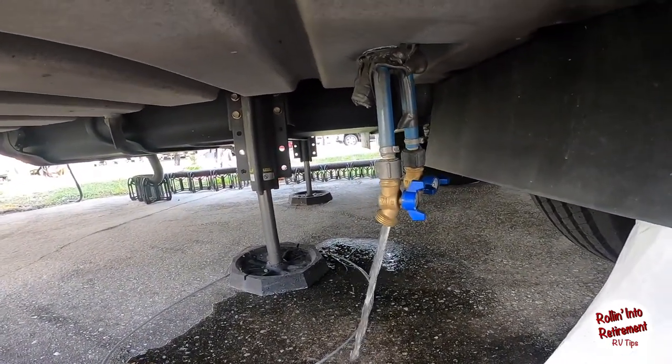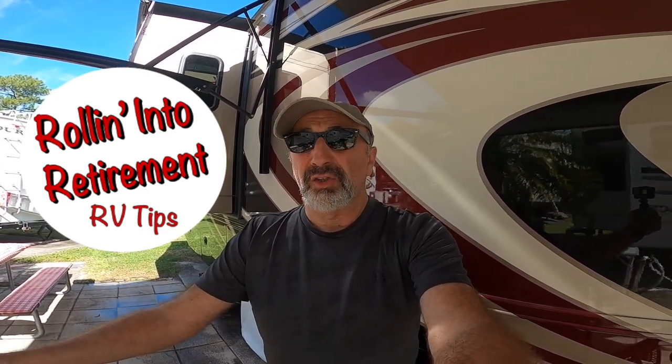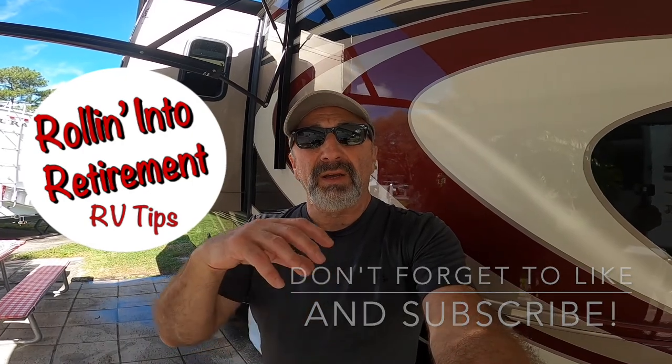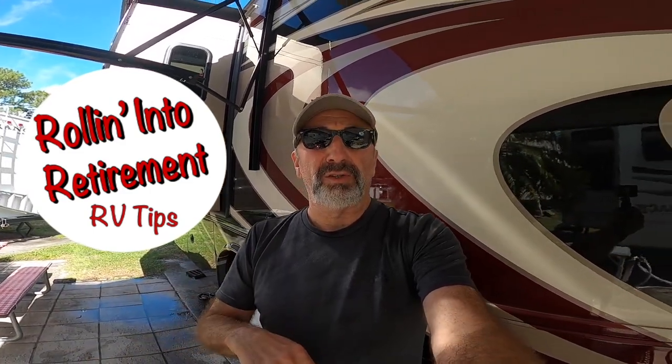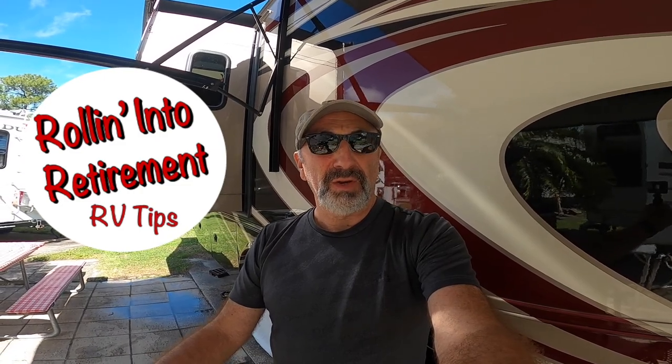Well that about does it. We've gone ahead and emptied what was left of the bleach mixture water that was in the freshwater holding tank. What we're going to do next is put some clean fresh water in again and flush it back out one more time. If you'd go ahead and smash that like button below, subscribe and hit that notification bell. Keep in mind the mixtures — I actually got that off the internet, so you can find it anywhere, but I'll put it in the description below, showing how much bleach per gallon you need. Thanks again, come back and see us for some more videos. Hope you enjoyed.